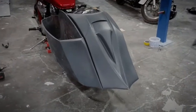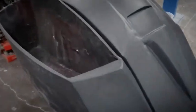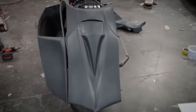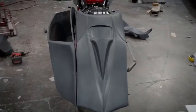This is the first bag bolted on, left side. I've got 1 bolt in there. I didn't put both in, but you can see how that should line up. That bolt is inside of that bag. You can see that down here in the crack a little bit. So your gap will be adjustable by moving the piece that's on the bottom of this bag, and that rail will set it this way or that way. And you could also use a jam nut on there if you want to set a different gap other than what it's going to come with when it bolts up. So we bolt that thing up tight, and we're going to get somewhere around 1/4 inch running down that bag. So I'm going to go ahead and bolt the other bag on so we can see that together, and then we'll move on to the side panels.